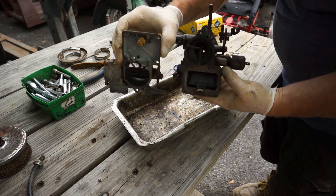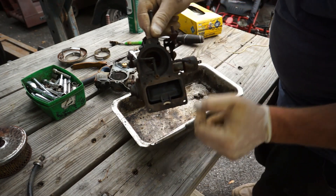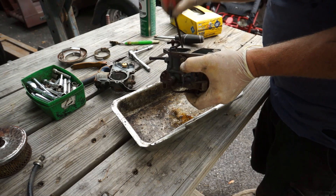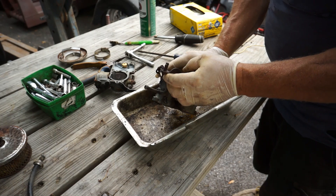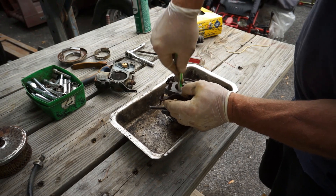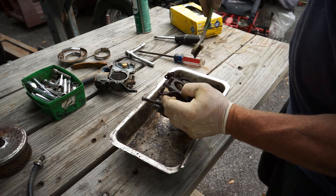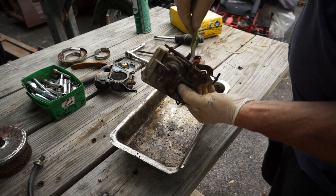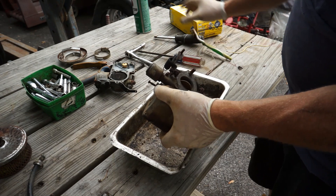It's been sitting for 12 years — crazy. There is a little bit of rust down on the butterfly down in there, which is expected, and that's going to give us a bit of an issue. But maybe I can open that up before ordering new parts and spray down in there and hit it with that brush to get that rust off. Even vinegar — if you let it sit and then hit it with a brush, it will come off.